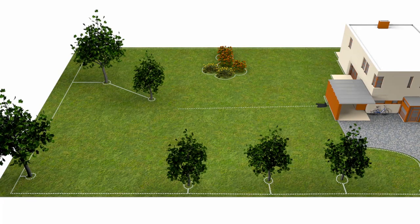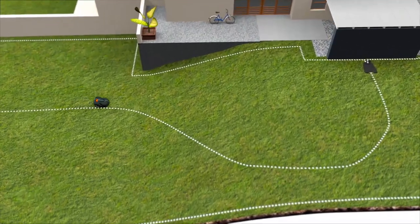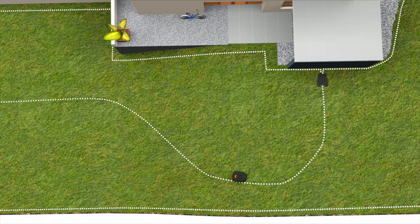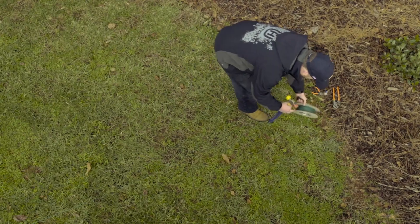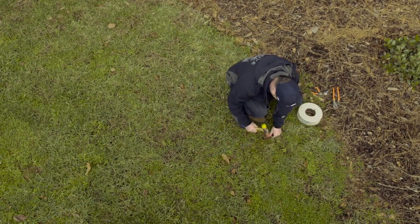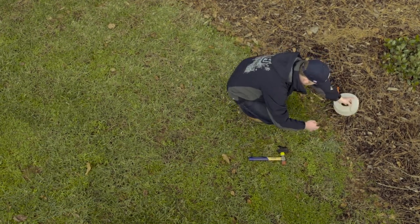In an open yard, lay the guide wire beginning at the charging station and run it to a central point on the opposite side. If you lay the guide wire on a slope, lay the wire diagonally so that the mower will have optimal traction. If you plan for the connection spot when you place the boundary wire, you'll have extra wire to connect the guide with the boundary wire. If not, you may need to extend the wire with another coupler.